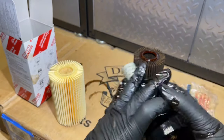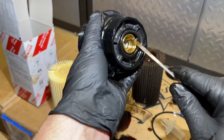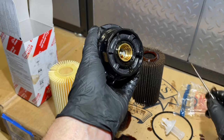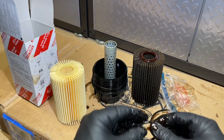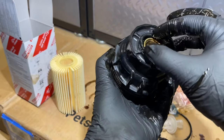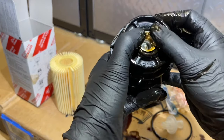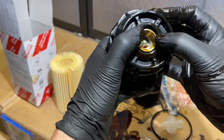In the nose, there's another O-ring right here. We're going to take our pick again, reach right in, and pop that one right out. Then we take our new smaller O-ring, slightly lubricate it just so it's not a dry seal, and press it down into place. It seems to sit pretty good in there.